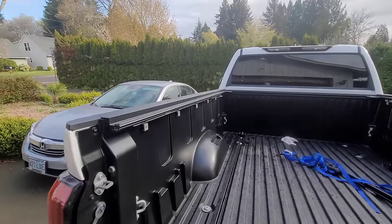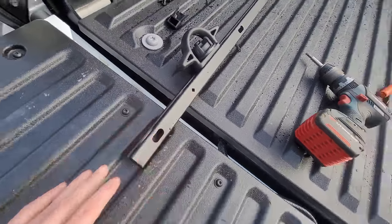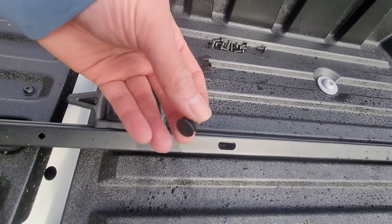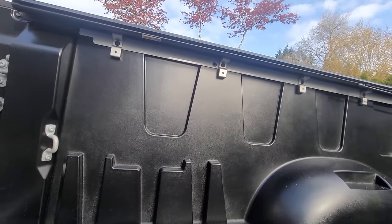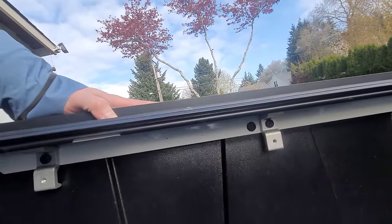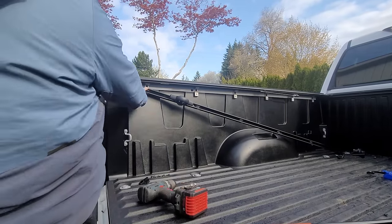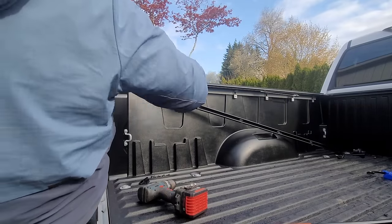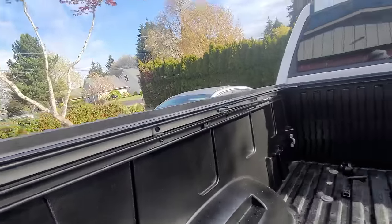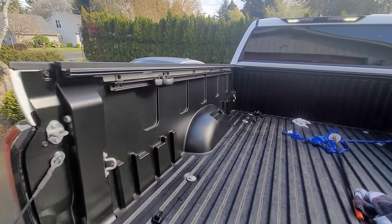Both left and right side rails are on. These are the OE rails - there's a little diamond figure here that goes toward the back. The Christmas tree on the OE rail: the instructions say to discard it, but I'm just going to stick it back in the hole - I can always take it out if I need to. It covers up the hole and looks nice and neat. This is a little tricky with one person, but it can be done. OE rails are back on.